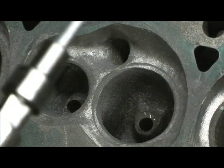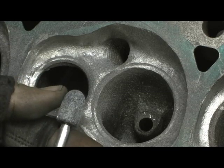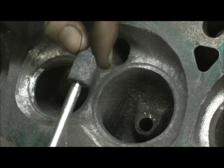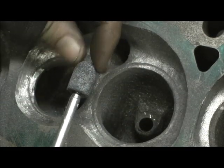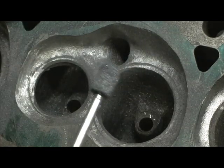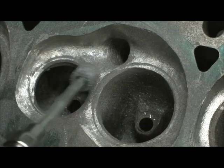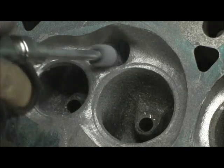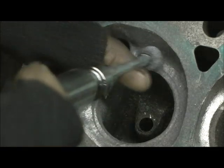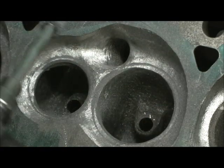Now the bad part is — you see my stone — you start off with a sharp stone, you can only use so much of it. I've got to put another stone on there, so you'll go through eight stones and you're only going to use about twenty percent of the stone on the end to do this job I just showed you. That doesn't mean the stone's worthless — it's just you can't use it to corner anymore. Then it becomes a surface thing, like right here, or on an edge where you've got a lot of cross-sectional area that you can lay open to work with.